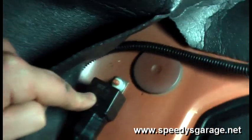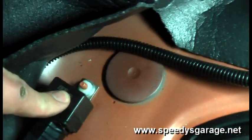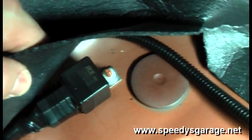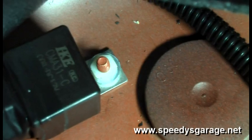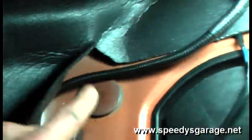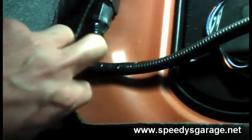Next, install your relay on the stud that's about 3 inches behind the fuel hat cover. Lay it over that stud — the kit comes with a metal washer; slide that down on top of the stud. The kit includes a plastic tab, but I decided to use a nylon nut, which allowed the stud to just cut its own threads and secure in place. You want the 4-pin connector to come down to the right going to the fuel hat, the 2-pin to go over the top, and the third branch runs underneath to the back of the car.